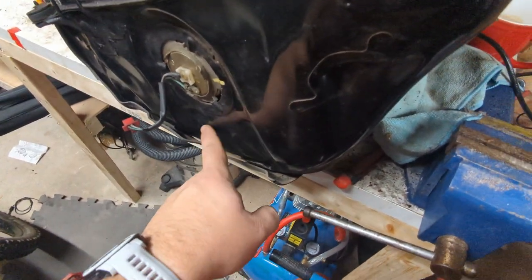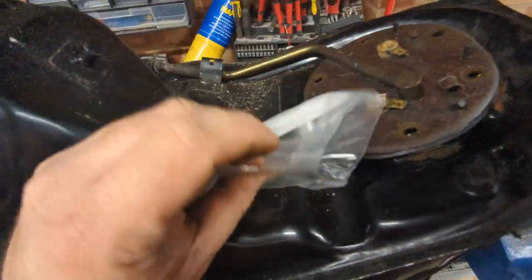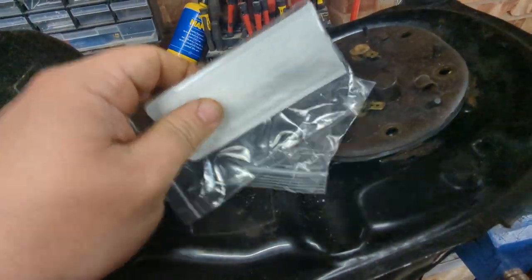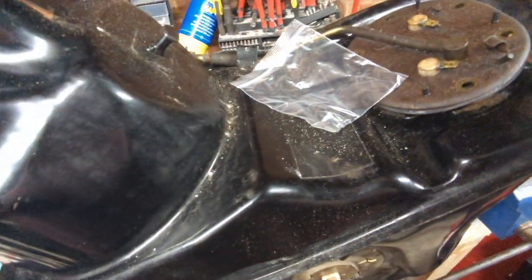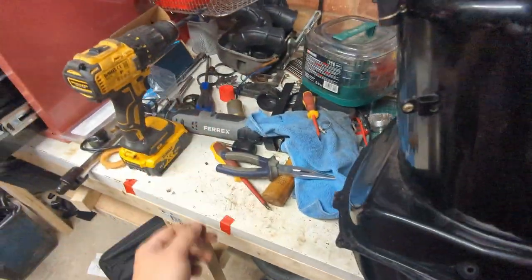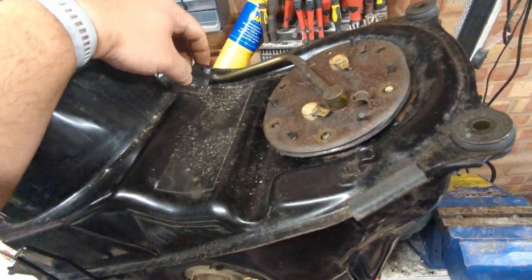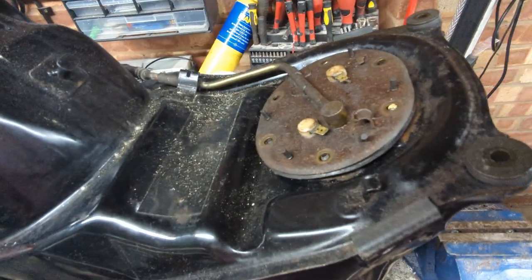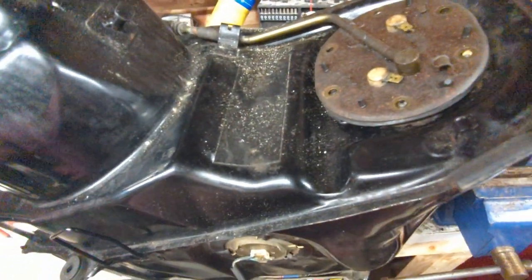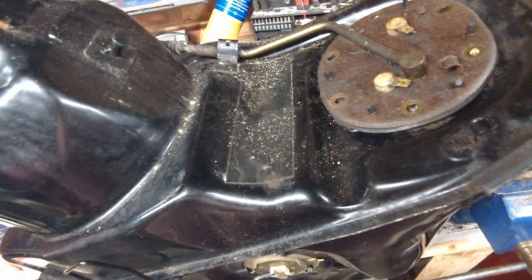sits there, and there's about an inch of clearance here between the end of the pump and the tank, so we might have to use this sock on it sort of sideways like that. That should give us the clearance we need. I'm not putting that on yet because they're a weird press fit that feels like it's going to break if you do it too many times. And then we've got the tank here, gasket, fuel feed and connections. So once we've got that all soldered up, we'll fit it in the tank.